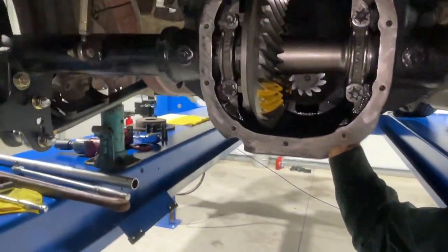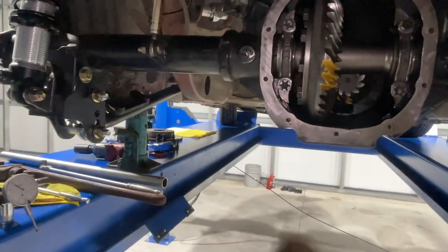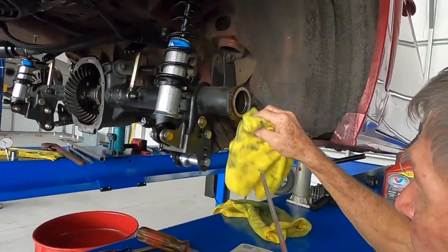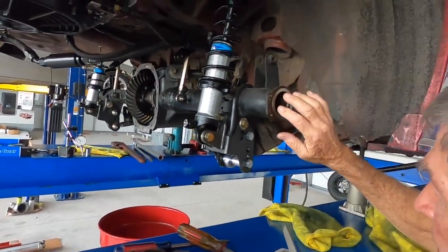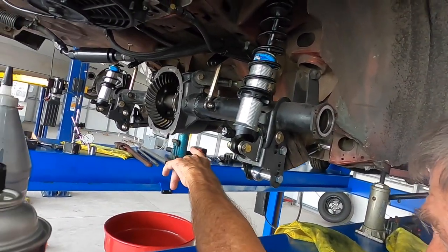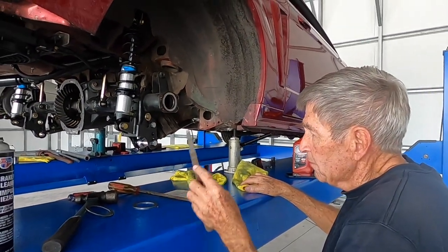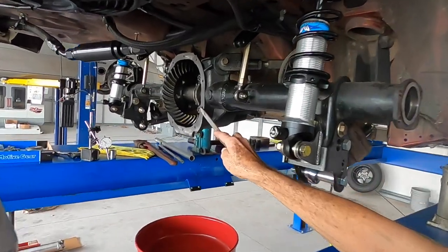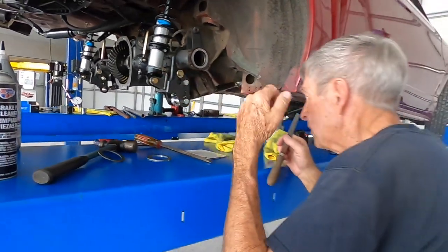After our first race we'll check it again. Make sure you get a flat face to work off of - the bearing isn't seated in yet. On any of your flattened surfaces, no matter where they are, I'm going to take the file and run it around so you don't have any pull-through or burrs when you bolt up. Just going to run the file around here a little bit just to make sure we're getting a good seal on it.